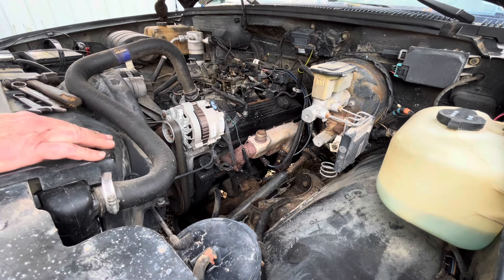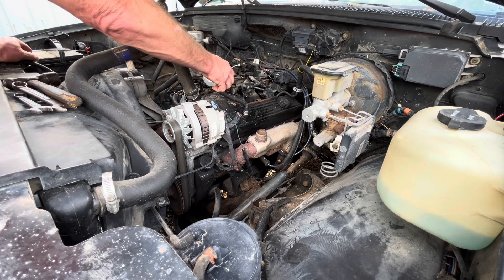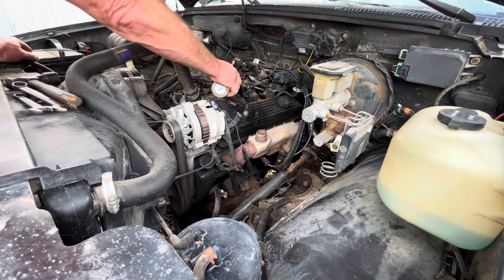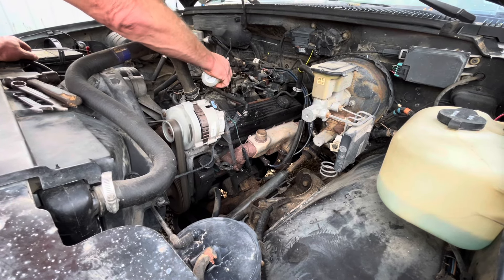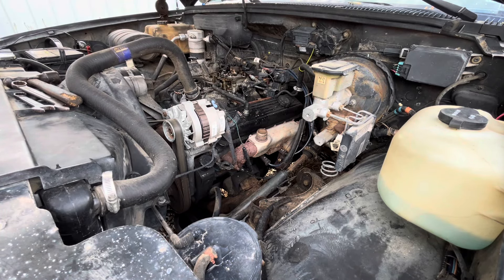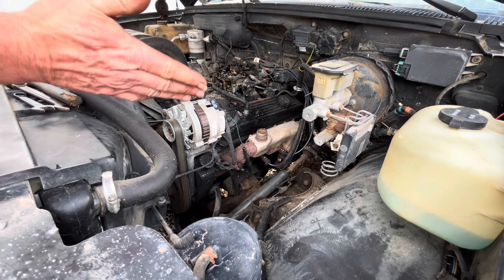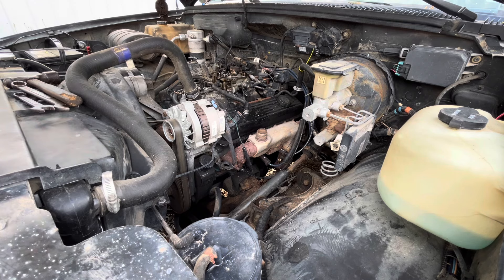There's stuff to do — honestly I had no time to film it all, and now this is a whole other project. The throttle body was actually stuck too. Outside the fan shroud it actually doesn't sound bad. You said you had 60 pounds of oil pressure? Yeah, it was stuck at 60, but before it was like 30. If you turn the ignition back off and on does the gauge reset back to zero? No it doesn't. Okay, that may be an oil pressure gauge issue. But that was a pretty uneventful 'Will It Run' — it ran.